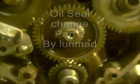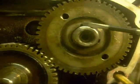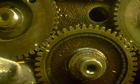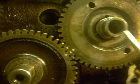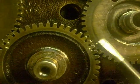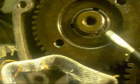Here's our timing side. The camshaft pinions have three slots — the slot you want to use is the keyway in the cam. There's a standard fitting: the keyway in the cam should point to the timing dot. That's the one you use. You can see the keyway and it points to the dot on the pinion.